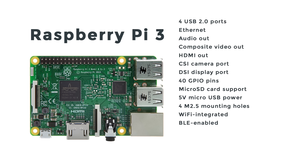Some other changes come into play when we compare the specs between the Pi 2 and the Pi 3. For example, the CPU got an upgrade to the Broadcom BCM2837 from the BCM2836. There are still four cores, however we're now looking at a 64-bit ARM V8 architecture up from an ARM V7. We also got a speed bump from 900 megahertz to 1.2 gigahertz.